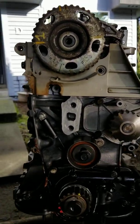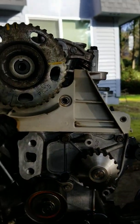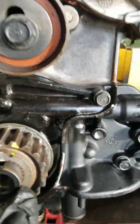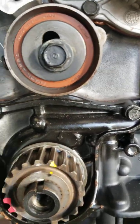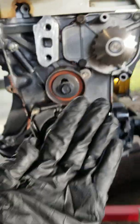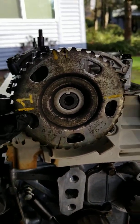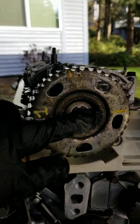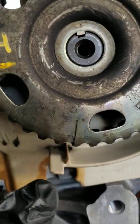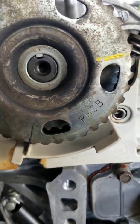So why does that matter? That's an important deal. Having the pulley on the crankshaft and the pulley on the camshaft the same, only the phase is changing. See this arrow and this yellow mark? There is a little dot — they have to be together. That means the piston is on top dead center, number one. Here is the dilemma: on the D15 1.5, these two marks are horizontal. On the D16, these marks and this reference have to be together. There are differences — this is 4.5 degrees, all that stuff.